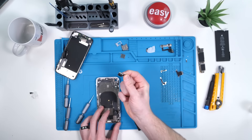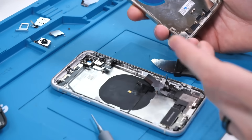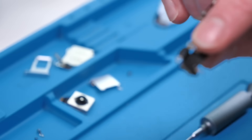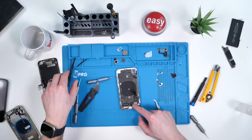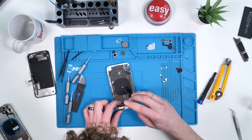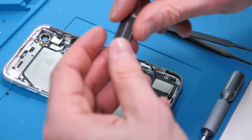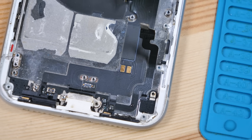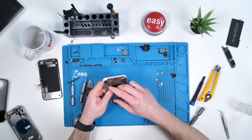We'll remove this shield and pop out the back camera. The new fake housing doesn't have the wireless charger, which is honestly quite hard to remove without damaging. Before we get to the charging port and the wireless charging, we have to remove these little antenna cables up here. We have the antenna — we'll transfer that over now to save time and energy later. Let's move on to the charging port and get that all removed. This is probably the hardest part about this whole thing — the charging port just has so many screws and it has multiple layers to it, so keeping track of these screws can be difficult. We'll disconnect the antenna, then disconnect the taptic engine and remove that. We'll unscrew the loudspeaker, which just connects via two contact points to the actual charging port flex cable, so it's very easy to remove. All that's left is the two bottom screws over here, and because we didn't take off the actual bottom pentalobe screws, we might run into some issues.